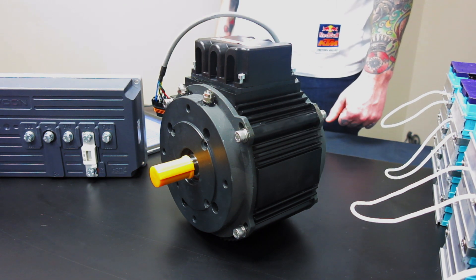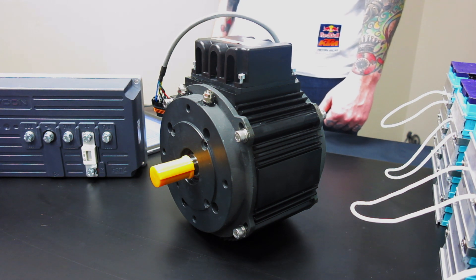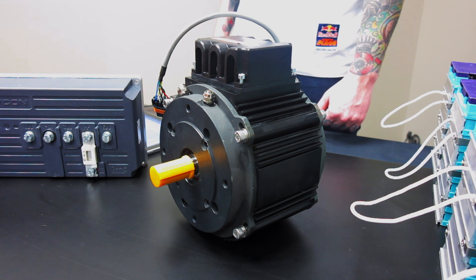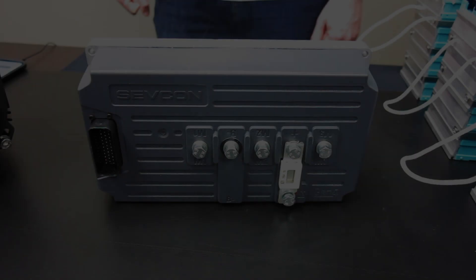For our motor, we have a Moto Energy ME 1304 permanent magnet AC motor. Huge shout out to Moto Energy for helping us out — they are leading the way in the EV motor market. This is one of the most powerful electric motorcycle motors out there. It has a published peak power of 42 kW and a peak torque of 90 Newton meters, or 66 foot-pounds. It has a sine cosine speed sensor which allows the controller to constantly monitor the amplitude of the sine wave to determine the speed and position of the rotor. This is a sealed enclosure, which is great for keeping debris from the road or dirt from the trail out of the motor, but it also means there are no openings or fans for cooling. So this motor is set up for liquid cooling, allowing us to pump coolant through to remove heat.